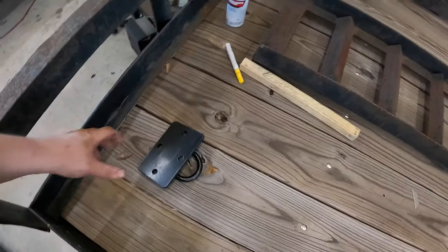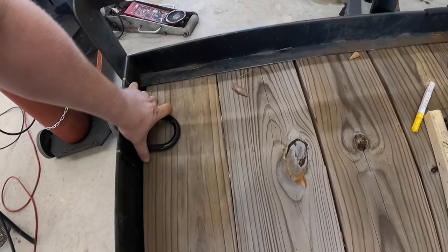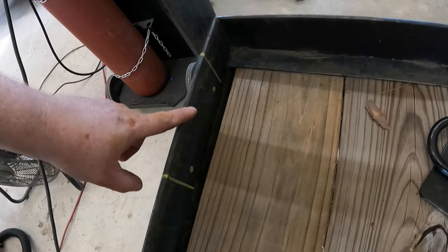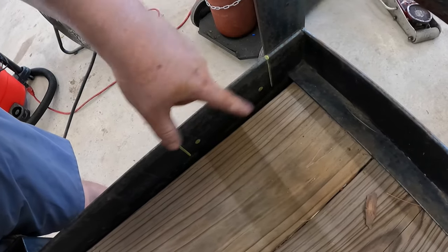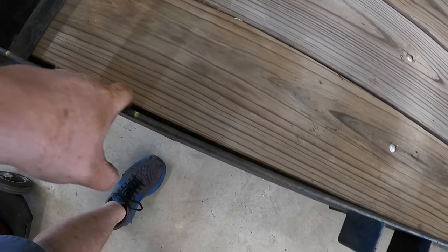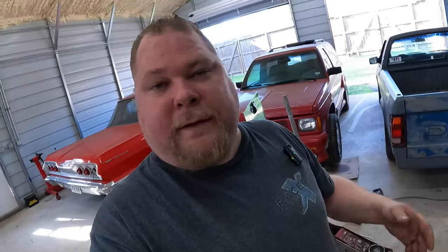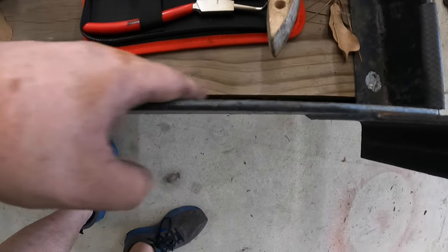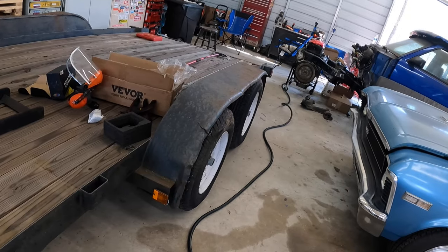I'm going to be mounting the D-rings about right here so that I have something to tie down to and don't have to go through the bars. I'm going to clean all this up so I can get ready to weld, then do the same thing on the other side. One thing I did do is come in here with a shop vac and cleaned out all the debris — because I'm worried about that stuff catching fire. On the other side you can see all kinds of leaves and debris in there, so we want to clean all that out. I'm going to put some water down there too, just to be safe — welding is hot. Then we'll do a little time lapse and move on to getting the fenders off.